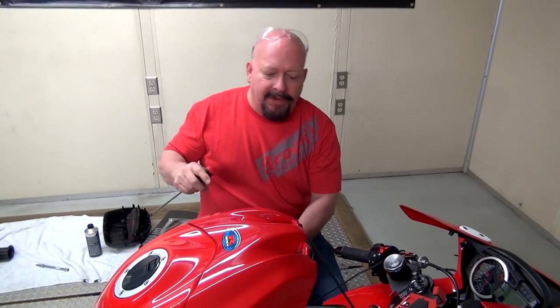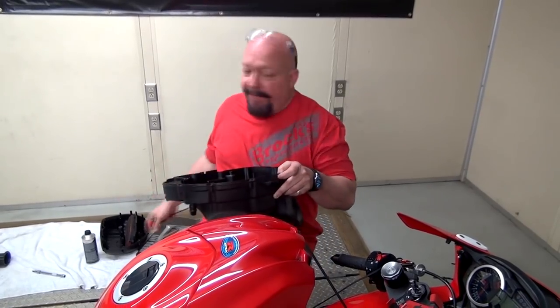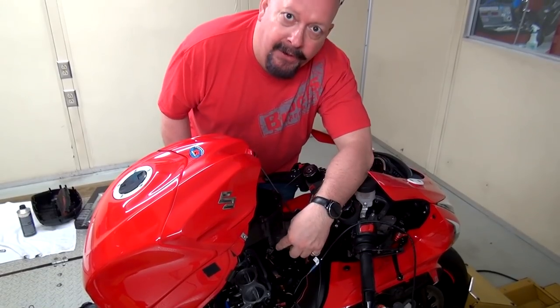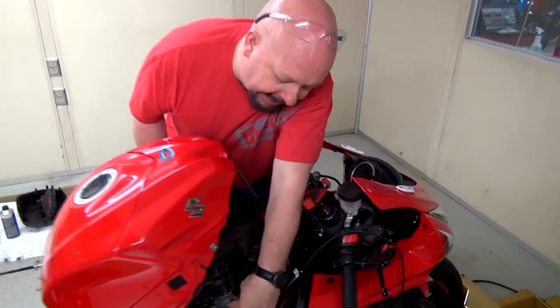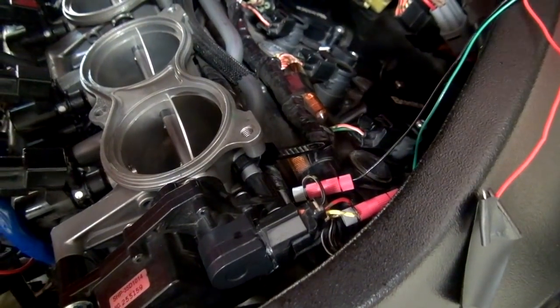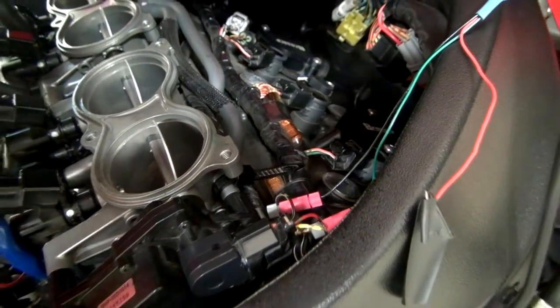We put some miles on the bike with the Wynn's power charge cleaner. Now we've got to put the airbox back in, and we're going to put in the Sprint filter, and that'll be our base run before I start tuning using the ECU. Because we're going to be tuning through the ECU and adjusting the operation of these secondary throttle plates, we're going to monitor it similar to what we did on Gixzilla so we can see where we're at. Then when we make our changes, this will allow us to confirm it.